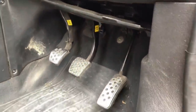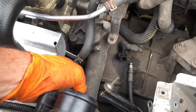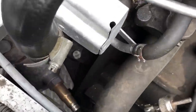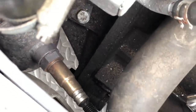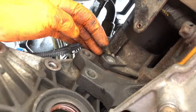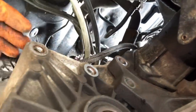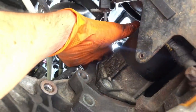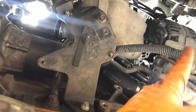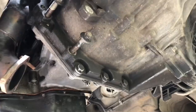Don't turn the steering wheel while you're doing this otherwise you mess up all the steering rack and the geometry. There are two 19mm bolts at the top to get to - one there and one underneath this water pipe. Once they're undone, get to the rest of the bolts down the side of the pre-cat from underneath. Underneath already I've got the bolts out of the starter - that's a 17mm, and two 19mms. The engine mount's been removed already; there's another bolt at the top of the starter motor. Once that's free, the starter motor could come out - you don't even have to unbolt anything off it, leave the alternator and charging loom all connected up.